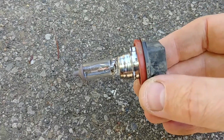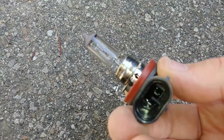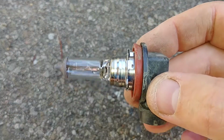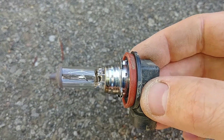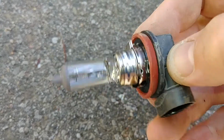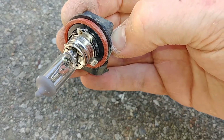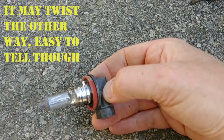Okay, here is the fog lamp bulb that I just took out. It's a whole thing, with the little seal on it here. This one is good, obviously, so I'll keep these should anything happen to the other ones, so I don't have to buy new ones. That's where the plug goes in. All I did was, it was sitting in like this, and you just twist it around this way, not much resistance, and then pull it straight out. So pretty straightforward.